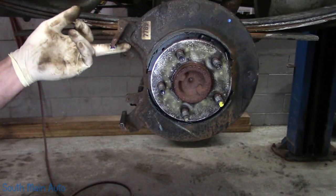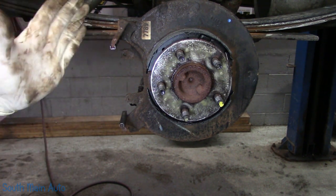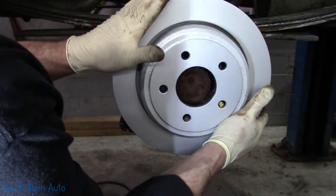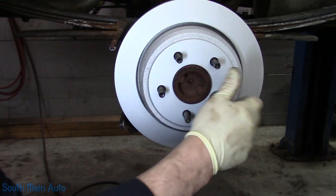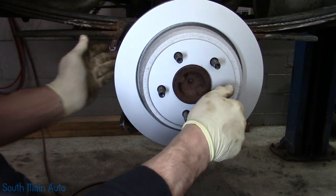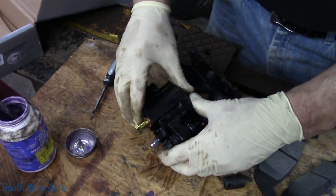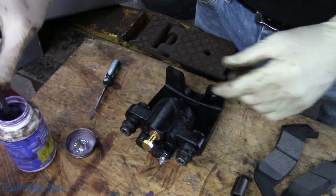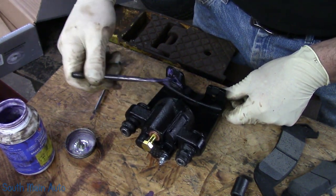Double installation — see what I did there? Once those babies are on, they're quite a bit longer than they need to be but they have little cutouts in them that go right to the edges. Don't smash in that little notch. Now we'll get our new poly-coated rotor, slip that baby on. Find us an axle nut — very old axle nut — stick that up there, just using it to take up space, make sure she's on. Let's get our caliper. Make sure our slider pins are good. We're going to take and grease it up — make sure you get some grease in those holes to keep her from getting all crusty.